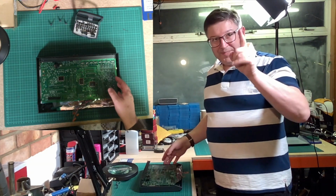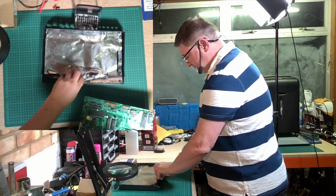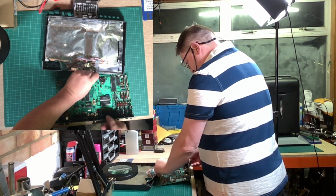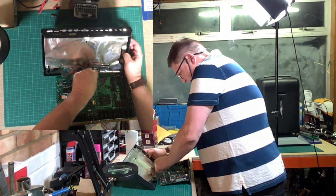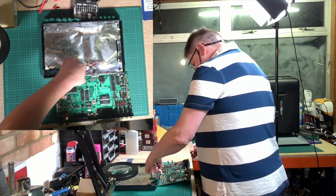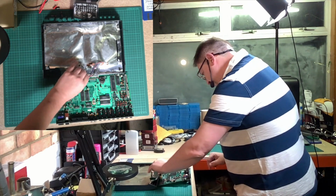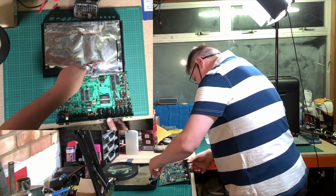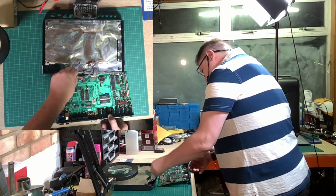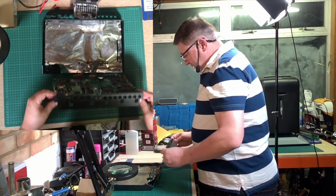I've actually missed a step. Got to plug the connectors in. So this long connector will only go in one way. Goes in there like so, and you just push it home. And then the blue wire goes into this one, and it actually says blue. You can't see that, but there is a symbol that says blue. So the blue wire goes in there. The red wire, therefore, can only go into the next one. And then this one here fits into there, because it's the only place it can go.